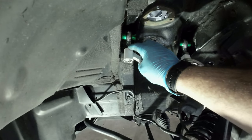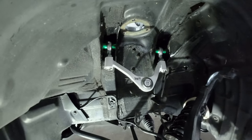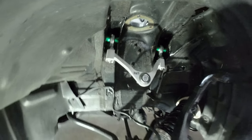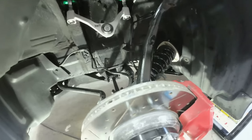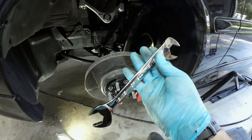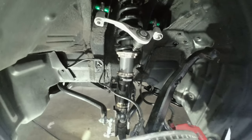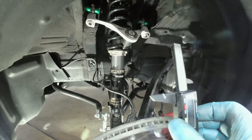Serial 9 recommends you put these to 150 foot-pounds on the jam nuts, and that's going to be a lot if you're just using a 15-16 wrench like this. I do have some leverage but it's going to be cheater bar and full strength to get that. Since I'm going to have so much more negative camber in the front, it's a good opportunity to go even lower in the front.